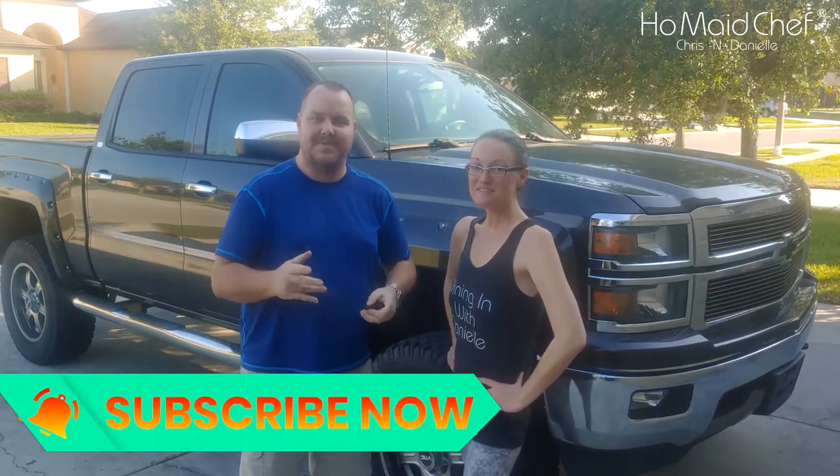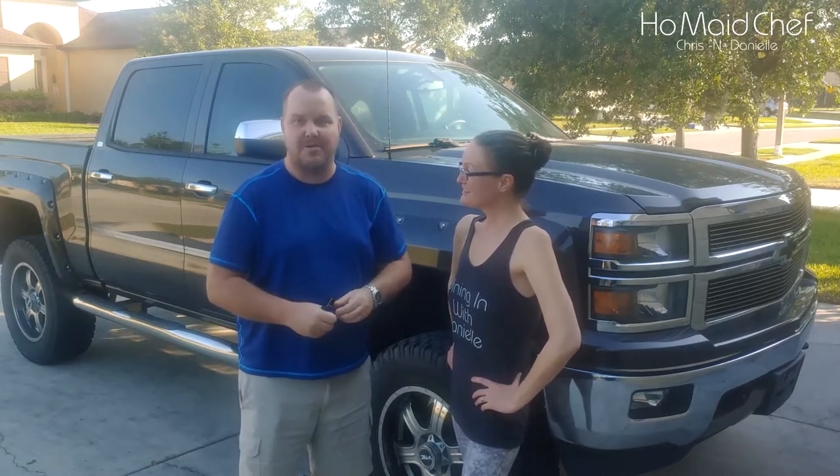My wife noticed this because we were going out and it was kind of a mess - it felt like we were being jerked with a trailer. I kept asking if we were in trailer mode because it felt like we kept skipping. So it was just a bad coil pack and it's a really simple job. I would also check, before you spend the money on this, unplug it and plug it back in to make sure it's just not corrosion and you just need to reset that connection. Also, when your computer light comes on, you just pull the negative battery cable off and let it sit - it will drain and the computer will lose that memory, and when you plug it back in you're fine.